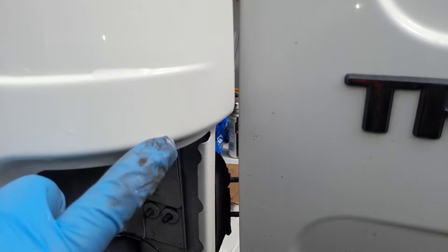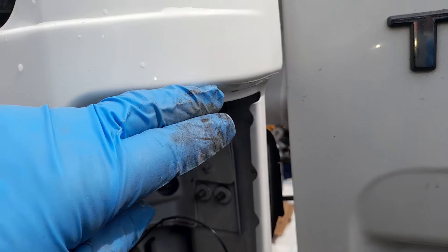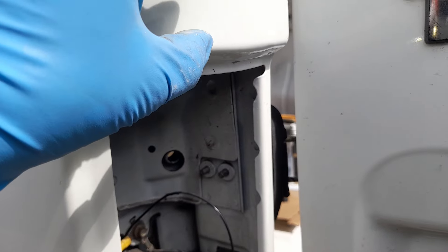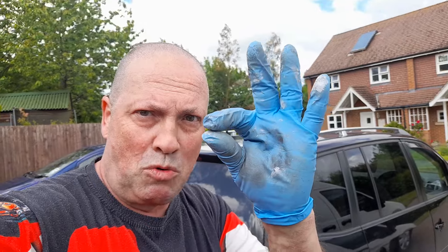The seal seems quite thick and when you start to pull the light fitting in with the thumb screws, the top and bottom of the light fitting tend to hit the recess - it seems like the height of the light fitting is about two mil too big, so instead of going into the recess it hits the metalwork either top or bottom. I'm going to have to think outside the box - perhaps get the angle grinder with a very fine paper and just take a mil or two off the top and bottom so it seats in properly. Otherwise that seal is going to be useless.